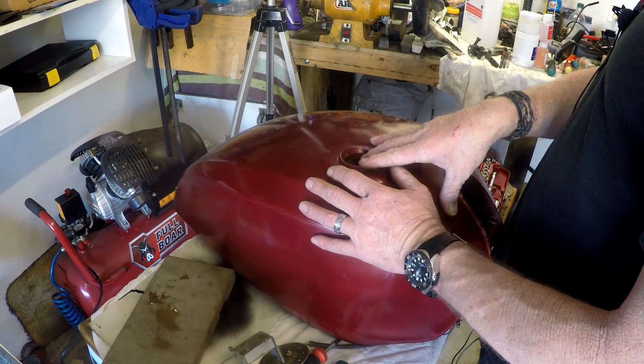This is going to take a number of days. It'll be a good day in the bath soaking, and then the treatment post-electrolysis involves passivating the surface, treating it with a liner, and letting it cure. From when the liner goes in, it's about a week before you can actually use it as a fuel tank. So this is not going to be a one-day turnaround video — what you're watching is a culmination of a week or two of work to get that fuel tank cleaned and relined. Let's crack on with it.